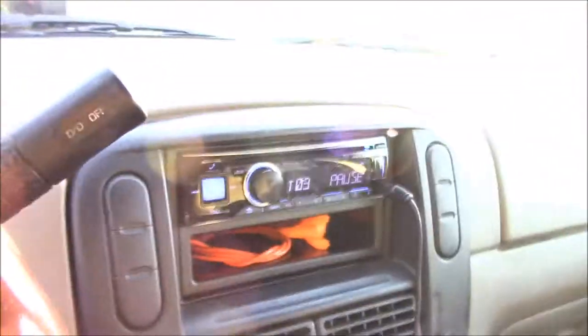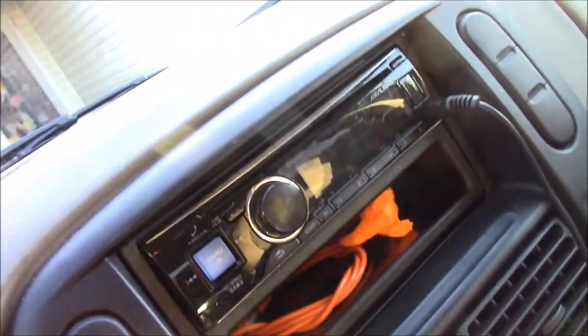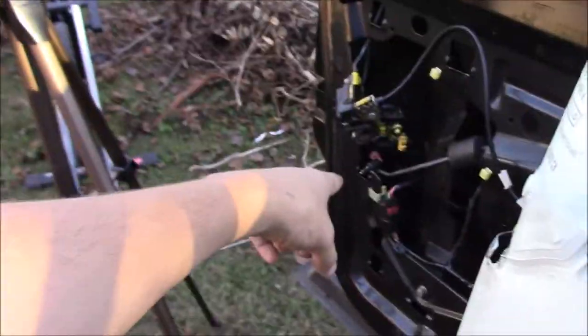I decided to go back and take the door ajar switch out - you remember we replaced those in an earlier video. I took the new door ajar switch out and put the old one back in and everything worked great. You can see I have my door ajar switch pulled out right here. If I press this in you'll hear a dinging - that's basically activating it. Whenever I push this in, the door ajar light comes on. That was our problem right there - that new switch was not getting pushed in right.